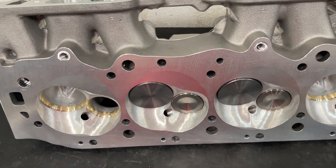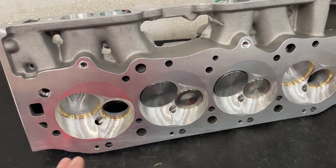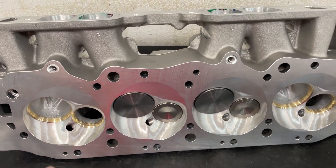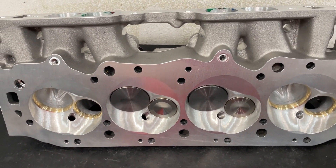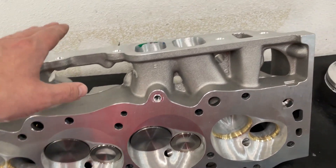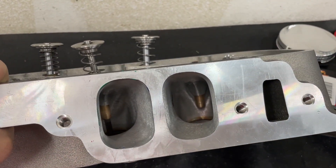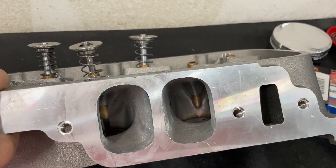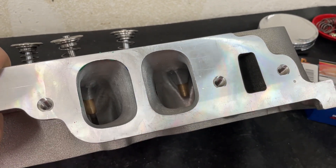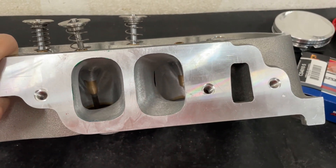Typically they flow about 485 out of the box, at least on my bench. This one's actually probably the smallest one I've ever done — it flows about 500 CFM. I'll show you the flow sheet in a minute. This is going on a pump gas 582. I did not try to make the runners larger at all, although they did get a little larger. My bigger versions flow way more, like 525. But this one I really wasn't trying to make larger because it's just a pump gas 582. It should be a really good deal for what he's wanting to do.